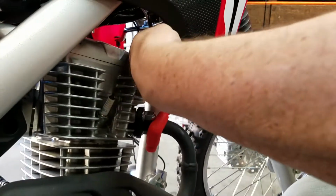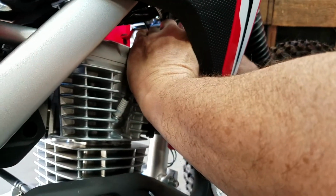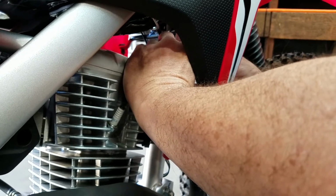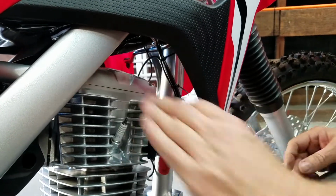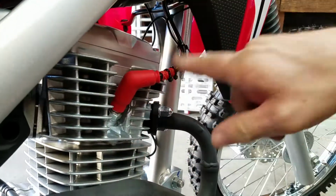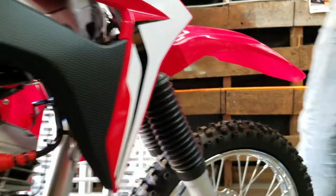So, how did they get the Kickstarter to do its thing? It has a gear that turns the clutch basket, which then turns the crankshaft. So the crankshaft is connected to the clutch basket. And once you kick it, the transmission turns. All that does is turn the engine, which turns the magneto, which then sparks it. Yeah. Okay.